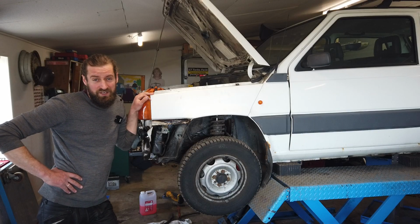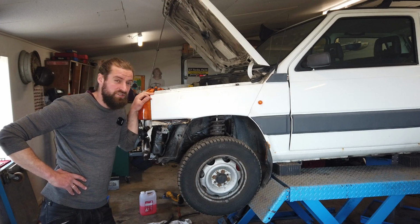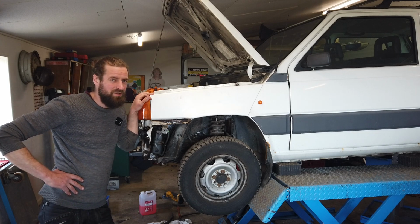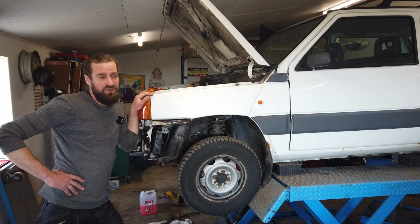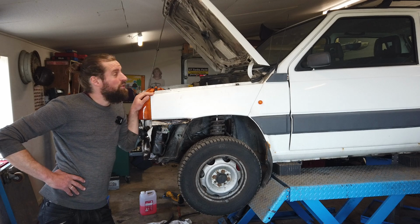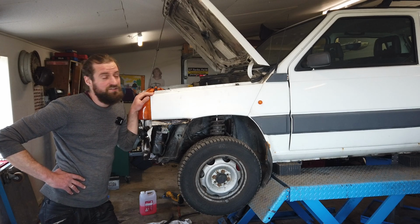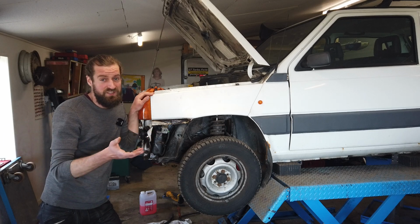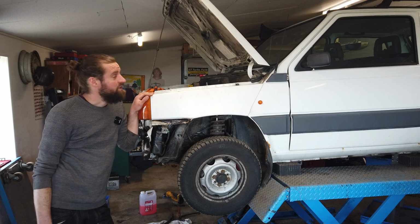Then I went about fitting an ECU. I do not have the original one, but I have one for the Cinquecento that is actually a Magneti Marelli or something like that, a performance ECU, but it's not really important about the performance. The important bit is that it's unlocked, so there is no immobilizer in it, because the original ECU is missing and it needs to correspond to the key, so that will work for now at least.